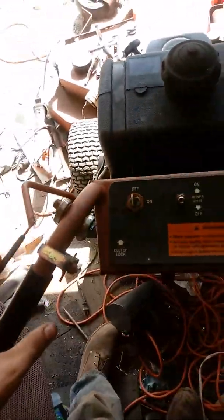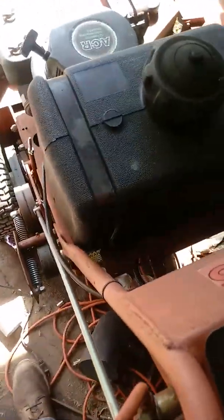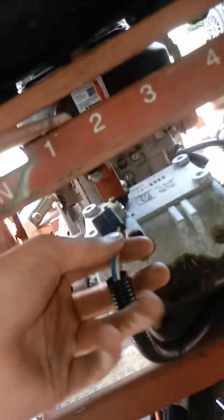This is how it works — that's the safety lever for the engagement. There are brakes on each side right there. These little switches hold the brakes in place — released and then engaged again. I'm going to try and find another one of those rubber pieces. So far what I've done, besides cutting the rust out, is I've cleaned out the engine and the gas tank — it had old gas in it. This is the neutral start switch, so if it's in any gear except neutral it won't start. But that switch doesn't work, so I had to just unplug it and now it starts pretty good.